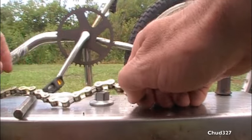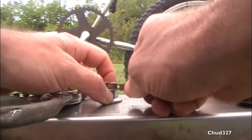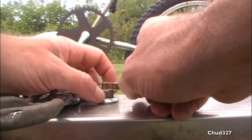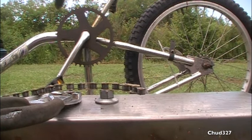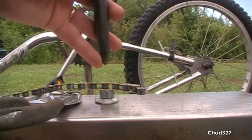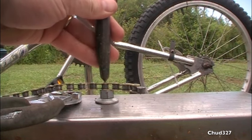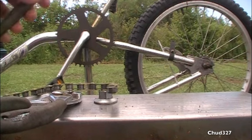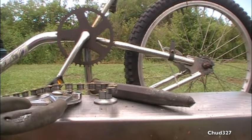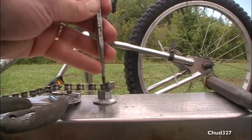I'm fighting with the magnet — it's supposed to be helping me. Okay, now you set up the punch. You put your punch right on that rivet and give it a tap, then get your other punch, the long skinny one, and drive it on out.